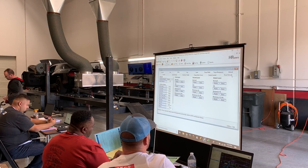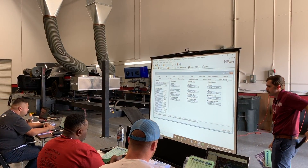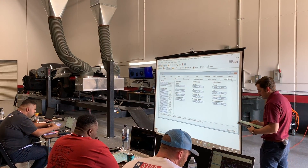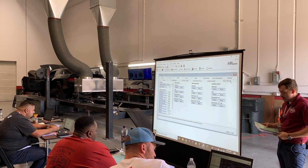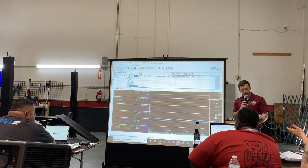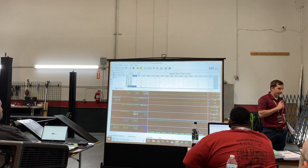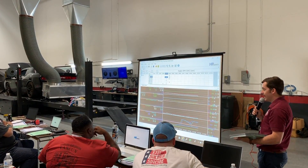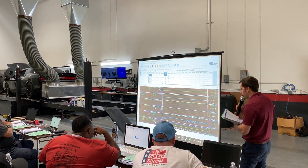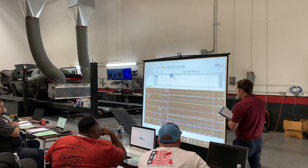If you go to your laminates, what does step one say to do? Read the VCM. That's done. What's step two say? Startup changes. What's the first step they're saying? If it was lean, you'd have to add fuel to the performance table. Rich is the presence of too much fuel, lean is the presence of not enough. We've added about 30% fuel to get us to our target. How do we know we're at our target? There's an oscillation going on.